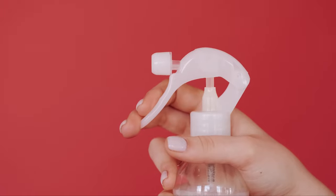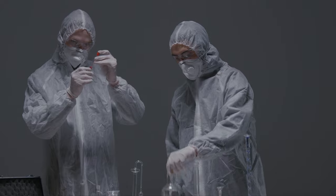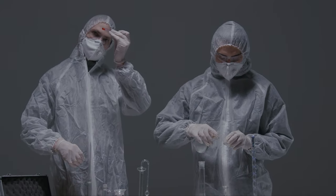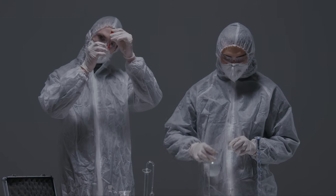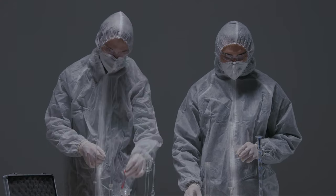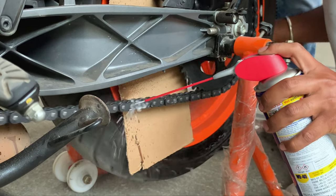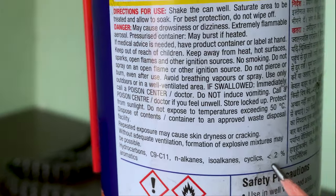The O-rings are best cleaned with kerosene, but I prefer to use WD-40. There have been myths saying that WD-40 damages the O-rings, but there are people who have soaked the O-rings inside WD-40 for nearly a year and have seen little to no difference. So it's safe to use WD-40 for cleaning the chain, though looking at its composition, I would not rely on it for its lubricating properties.